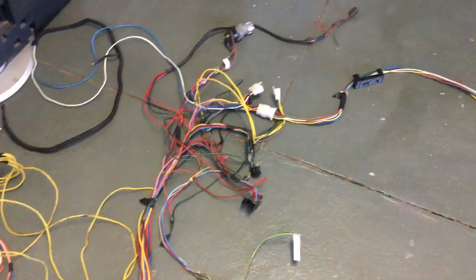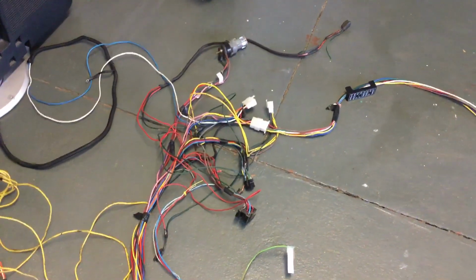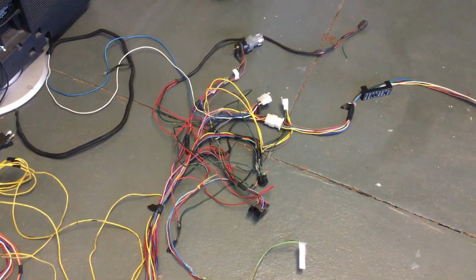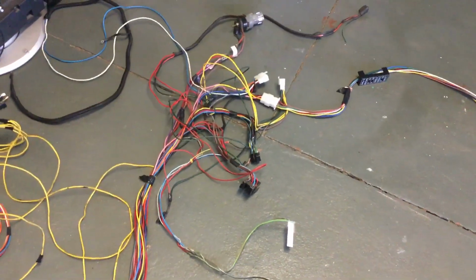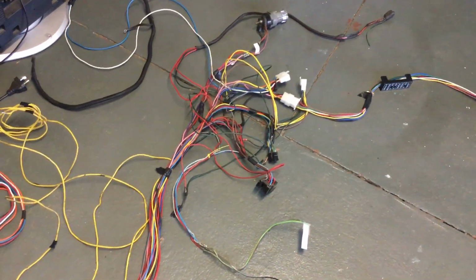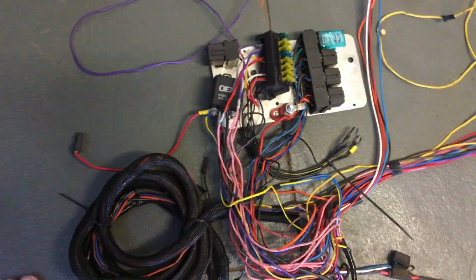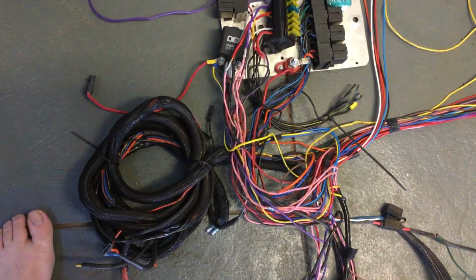So with my battery being in the back, it had basically a 10mm battery cable going to the bumper mount, and I could see daylight between the bolt and the spring washer. It wasn't bare metalled. Then the main ground from the battery negative went to the transmission mount and not the block. So after a period of time, that killed the ignition coil, and fried the capacitor in the module. All had to be sent back to ICE in Victoria.